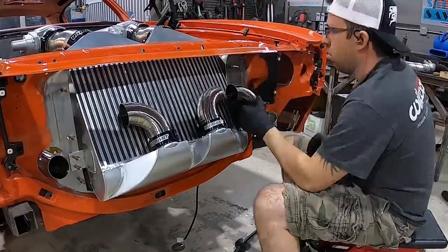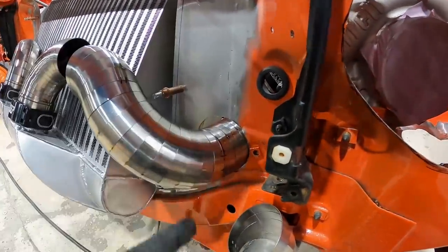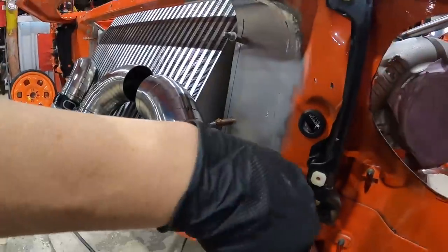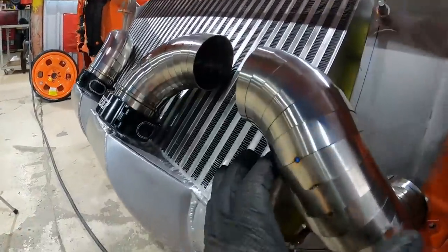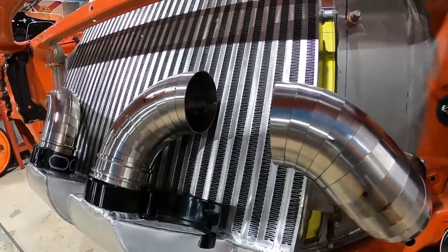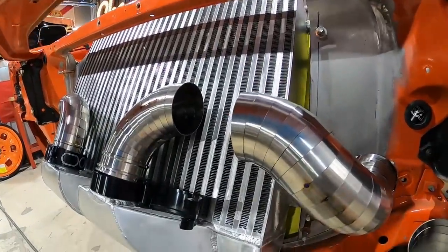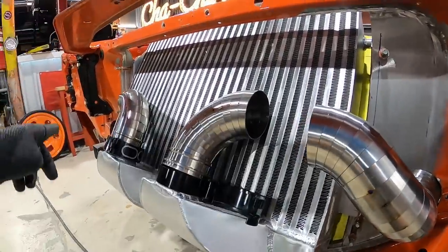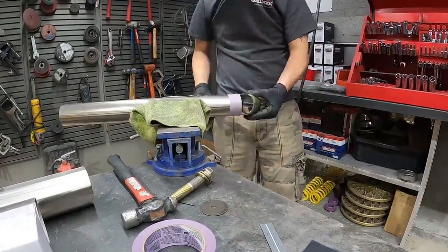I had to add a quarter inch of material on the HD flange on the turbo side just to drop that bend down a little bit to make it in that hole — so we have one 90 there, another 90 there, and then a 45. I'm going to cut a two and three quarter inch stretch right now and tack it into place. The driver's side is going to be all tacked up and ready to go. All we're going to do is transfer all of our bends over to the passenger side and try to get a nice even look for the cold side of the turbo system.